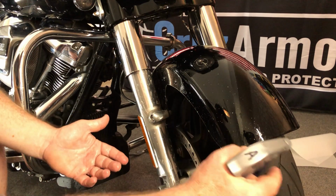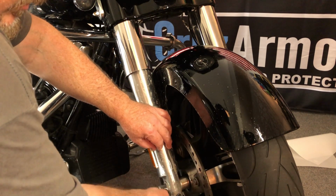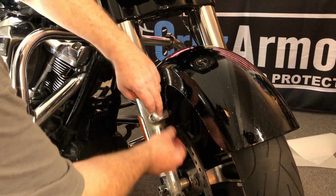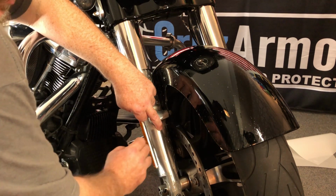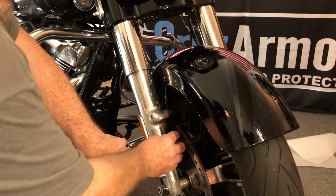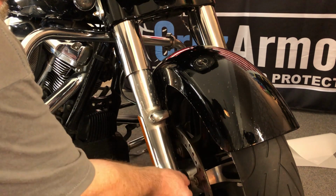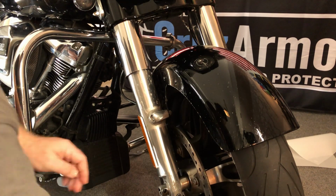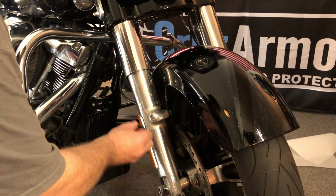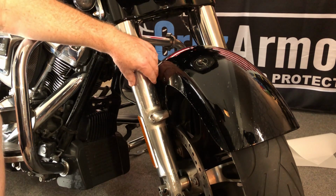If you have your alcohol mix, you can use that down here to anchor the bottom, so that won't move. And then you just slowly, like I say, from here, you work your way up. And then you just start working from center out towards this reflector light. Then you do the same thing inward. You start at center and work your way outward. And that's good. If there's anywhere that's lifting up or you're getting fingers, just use the alcohol and that'll lock her down. And if you get a couple little fingers here, just leave them for now. We'll get back to those in a minute.